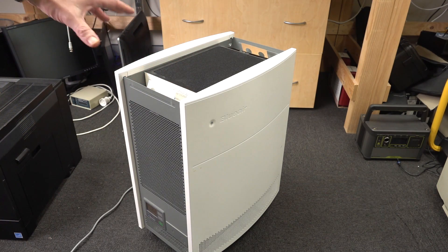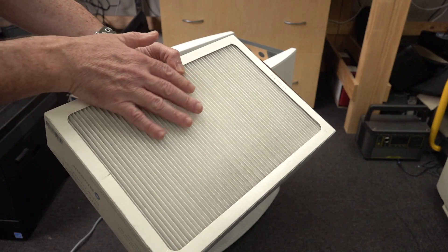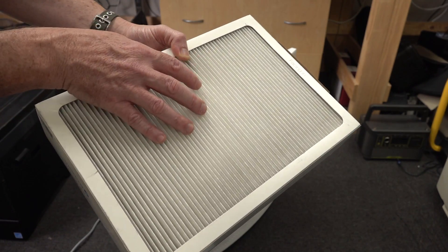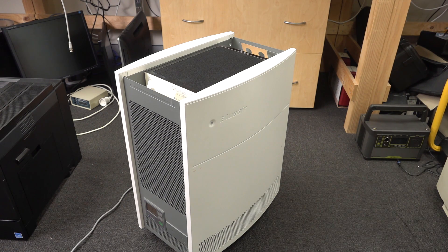There's an additional technology in air filters which this one has — an electrostatic filter. What it does is it charges up the particulate matter in the air using high-voltage probe tips that energize the air. It's effectively like a negative ion generator that charges up the particles. Charged particles then electrostatically stick to the filter material, which just increases effectiveness. Rather than just forcing particles through, they couple electrostatically to the material itself. If you combine HEPA filter material with electrostatic technology, it becomes really effective — so a good air filter should have both.